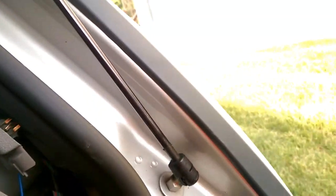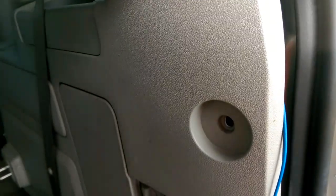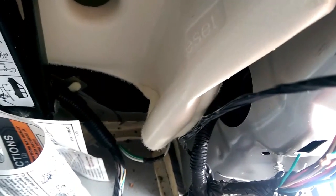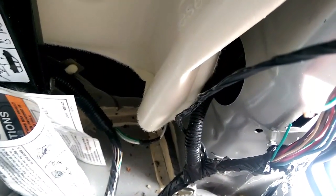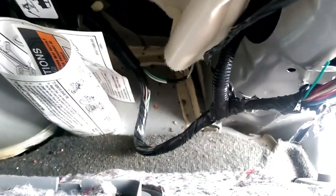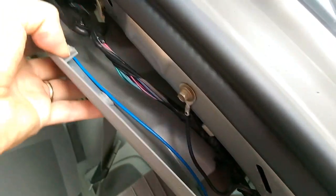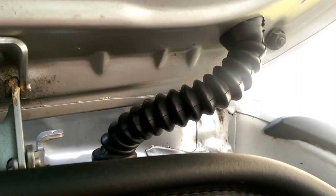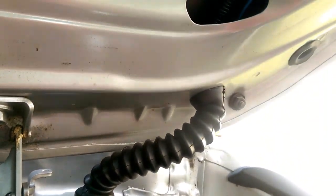Just to show you inside here — I did remove the panels, which is not difficult but kind of a pain to peel off. The wiring for the brake lights and reverse lights snakes into this hole here, so it's not easy to get to. You could get to the wire somewhere in here, but you've got to figure out the colors, and then you've got to go up through here, underneath the roof panel, and then there's this rubber tube that connects from the main body up to the tailgate, then go all the way through.